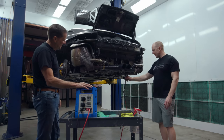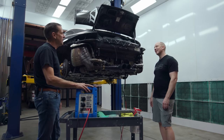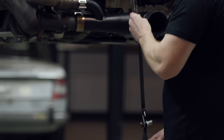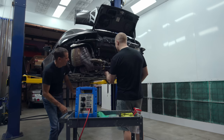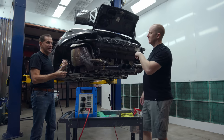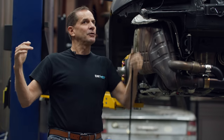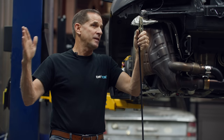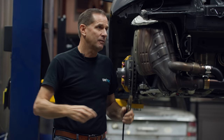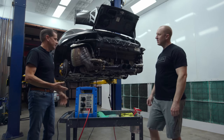The tarp strap doesn't come with the kit — you gotta buy your own. Now for setup: it's a typical ground lead. Always disconnect the battery so you don't nuke the electronic system. You want to always work behind the ground. If the exhaust system is here, put the ground as close to the farthest point you're going to clean. If this is the tailpipe, don't put the ground on the tailpipe — clip it at the header bracket, the actual manifold piece. If you don't get a good ground, it just won't work.